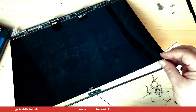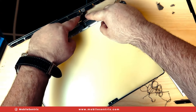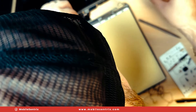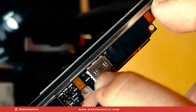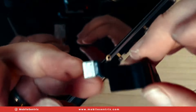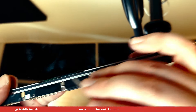So now we can gently lift on the panel and carefully set it down. You need to be really careful about this flex here. This connector is a little bit unique. I'm going to add some isopropyl alcohol to the bracket to help break up the adhesive. Now we can go deal with pulling this out — there are two little prongs that stick up in there; you need to push them down to pull it out. Just like that. We need to transfer this metal bar that goes across the back.